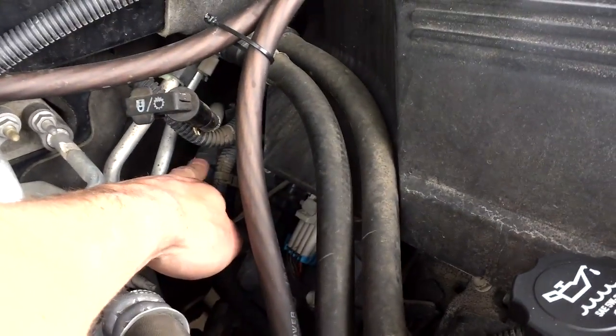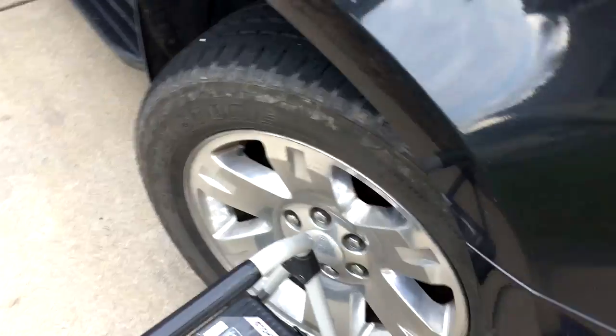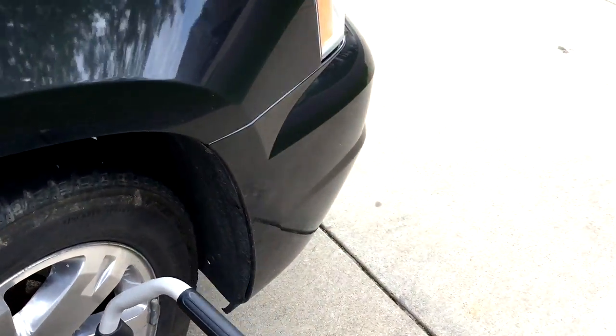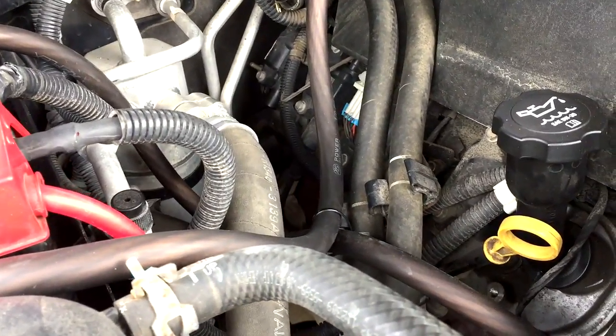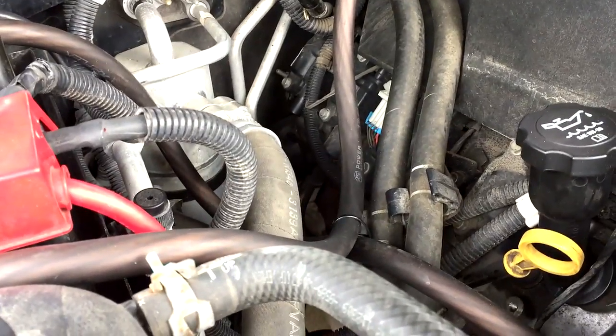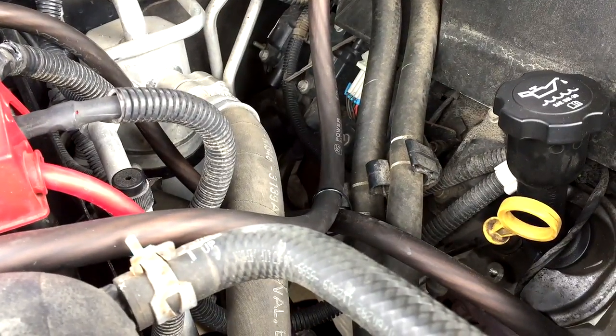When I got to this one it was like wow, what the heck. At first I tried it through the sidewall with an 8-inch extension — I took the front tire off, pulled off all the covering under there, and tried it that way, but that didn't work very well. That was a Sunday and I ran out of time, so that day I got every other single spark plug done except for number eight.